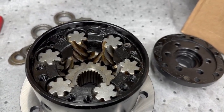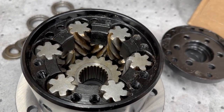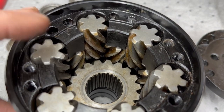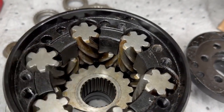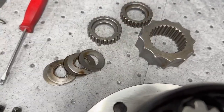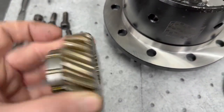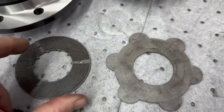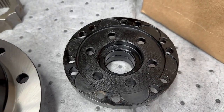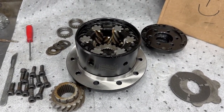I'm glad I pulled it apart — this has been floating around for probably 12 years. That isn't rust, it's a sort of grease finish. I'm going to completely strip this, clean it, and put it back together. This is the standard ATB setup: the outer drive gear at the bottom with grooves for the oil — not on the normal ATBs. Then you've got the bottom set of six gears, the top set of six gears, and into here goes the assembly: a drive plate, some gears, and spring plates that preload it. Those are the bolts that hold it together. Over here is the special bit — a drive plate and the carbon fiber additional pad, which goes on top. You can see where the extra machining has been done. I'm going to completely take this apart, clean it up, and put it back together before continuing — it's just too nice to let it go out like this.